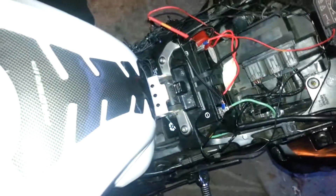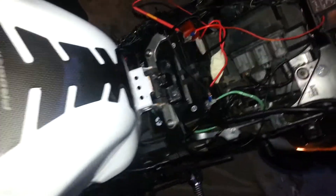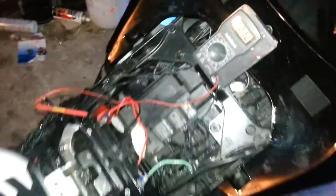Right now the battery had issues — it wasn't turning over when I got to 7-Eleven. So I went through a series of trying to look at things, and I already went on Amazon to put in my cart the stator, the coils that I'm going to replace, and then the rectifier that's right here. It looks like easy installs either way, but before I go and spend the money, I wanted to make sure.